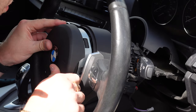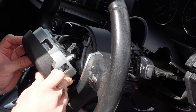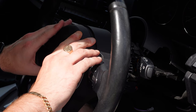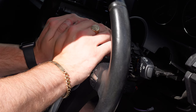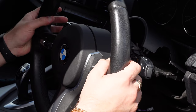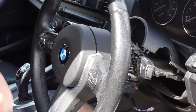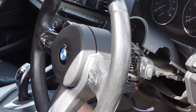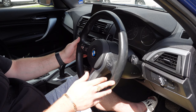Then connect your airbag up — just like that. Make sure you get the correct airbag: in the US they use a three-stage; in the UK they use a single stage. Once that's in, push the airbag into position with everything aligned correctly and that's your new steering wheel fitted. As you can see, it looks much much better. Reconnect the cowling — the bottom piece and the top piece — and the steering wheel retrofit is complete.